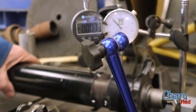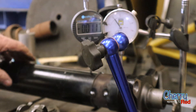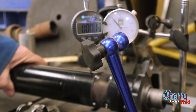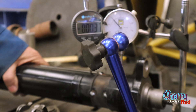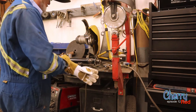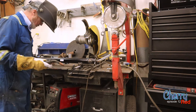I don't think I could have got that better with a lathe. It's got high and low spots, but they're not alignment issues — it's out of round. From one side to the other it's really close; take the 90-degree side and it's bang on. I'm letting this cool considerably between welds because I don't want to melt the rubber seal. Now we'll do some welding in between.